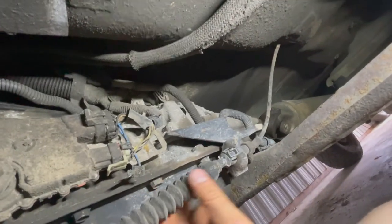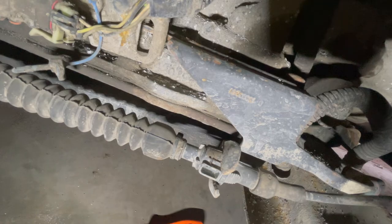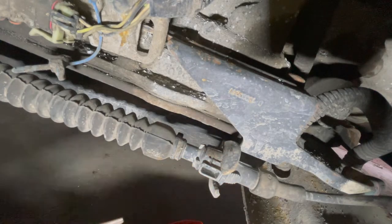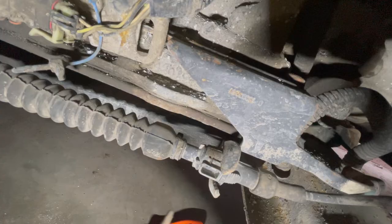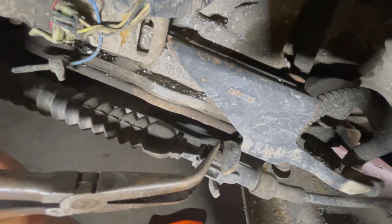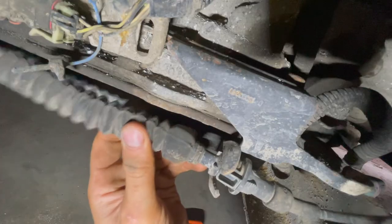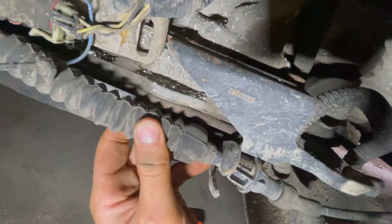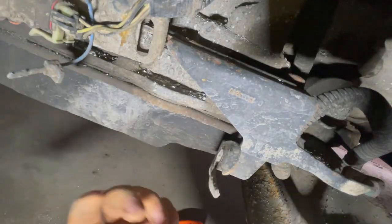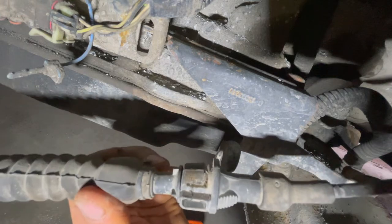That's off. All we've got to do is compress these and then we can take the whole cable out. I'm going to try to get a better camera angle on this mechanism to show you exactly how it works. The two push tabs - kind of like fangs - pop out when you install the cable at the factory. So what I'm going to do is spin my pliers around, compress both sides at the same time, and then shimmy and wiggle this backwards - just like that. Now that that's out, this should come all the way through. There's a hole here and this is your removal location. Push it back and the cable's removed. All we have to do is draw it up through the hole in the floor where the grommet is, and then we're ready to inspect the new part for installation.